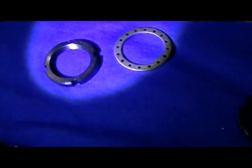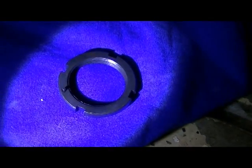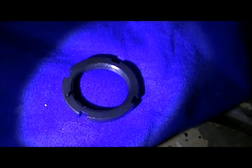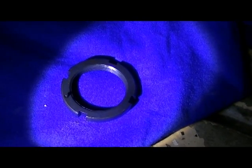Alright, so with the kit comes the locking nut conversion kit. So you got one part that has a little teeny pin on it, and the other one doesn't. Then you got this little locking ring. So this guy goes on first. This is going to be your bearing adjusting nut. It's going to go on with the pin facing you to the outside of the vehicle. This is where you're going to get your bearing adjustment. You don't want it too tight and you don't want it too loose. So it's one of those things you're going to have to deal with.